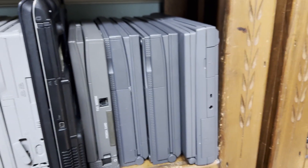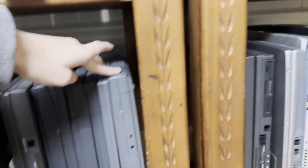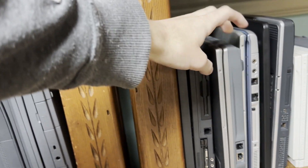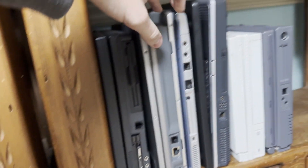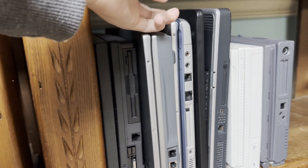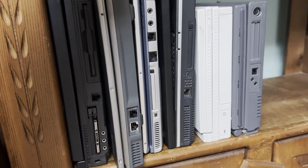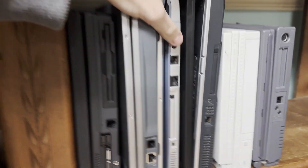Winbooks - these were all made by different companies: Jetta, ASE, Quanta, Twinhead, Alphatop, ECS. They're all different companies, and all of these are brittle. Through to Twinhead, I think this Alphatop here is starting to get brittle - Green 720. And then the ECS machines - this one is hard to tell because the display cover is metal. This one, the Green 732, aka the Winbook J4 - this is brittle. The hinge mounts on mine blew out and it seems to be a common problem. So these are starting to get brittle, and this is from 2002.